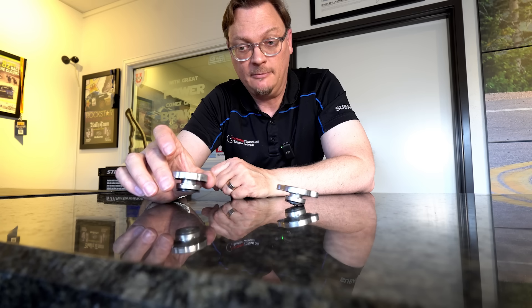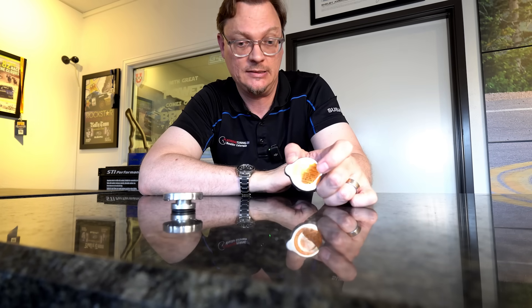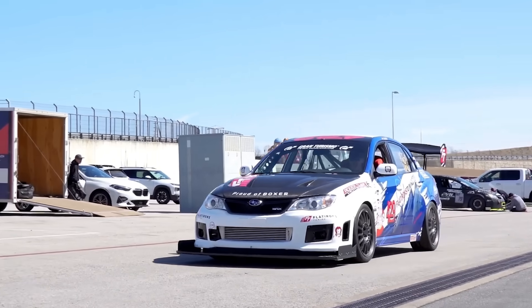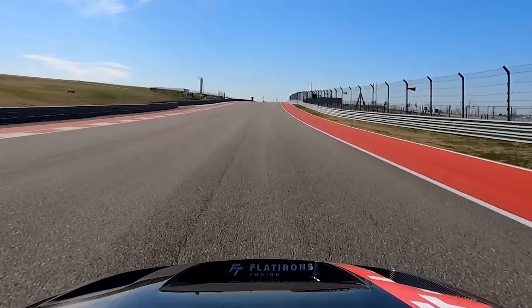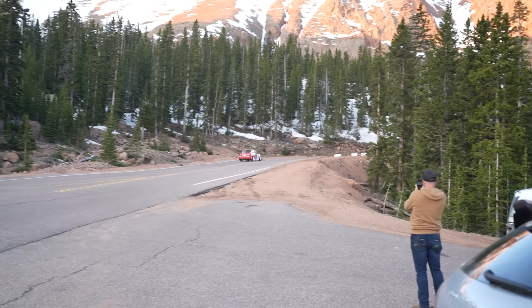But no matter what comes on that radiator, no matter what anybody else tells you, it's got to be a one-way cap on the radiator, and you can only have one two-way cap in the system, which has got to be the one on the expansion tank, because the expansion tank is the high point in the system. Way back when, the mistake that we made — that you definitely do not want to repeat — is that we had two two-way caps of the exact same pressure: one on the radiator, one on the expansion tank. When you have that, because now coolant can come back into the radiator as well as the expansion tank, the system does not properly burp air out of itself, and that is what can basically compromise the cooling system. That was causing a lot of our cooling issues for maybe as many as five years, until we found out about this difference — why these caps go where they go, how they work, and what to look for.